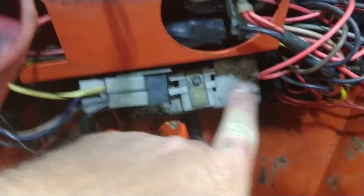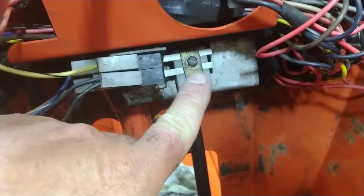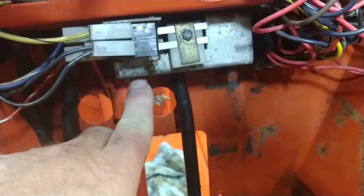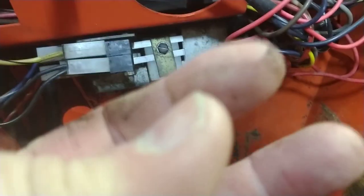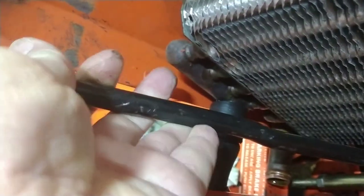This assembly here is what you call your neutral safety switch — it has two switches on it. You have to remove that; there's a 7/16 bolt in here and you just take those bolts off, they're pretty easy. Then you pull it forward and that gives you the play you need to be able to lift this whole lever rod — this is the control lever — you have to lift it up a little bit.